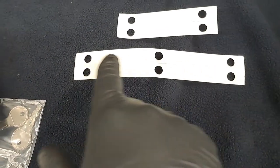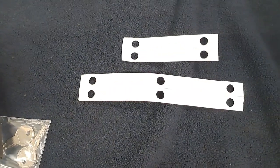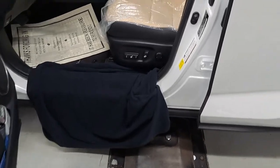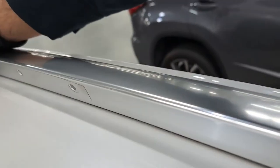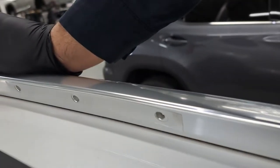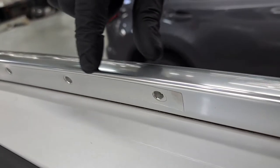You're going to use a sticky pad with three holes for the front of the vehicle, and the one with two holes for the rear. I have the vehicle covered where I'm going to stand so I can install my clear sticker. Right here where the three holes are, you can see there's a clear sticker on there — you want to leave the holes exposed because that's where your crossbar is going to go.